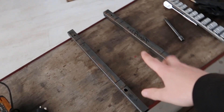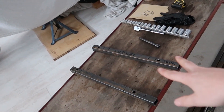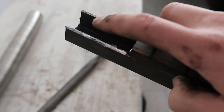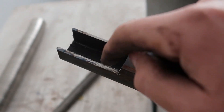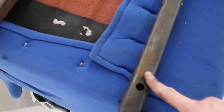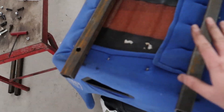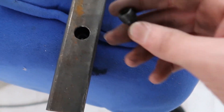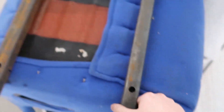Let's get the passenger seat out then. So we tried these in the passenger seat and actually they're the same as the driver's seat, so now I've got to cut these up. It's definitely not fun cutting this. So we've just chopped the ends off on the front so we can get the nut in — on the car it has a stud on the front and a bolt on the rear so I have to cut that out. We've got the passenger one done now. We've put an allen key bolt through, drilled this hole a bit bigger so the head goes through, and then the bottom one to that size. Sturdy — just needs tacking on now.